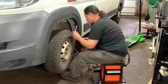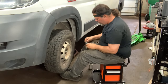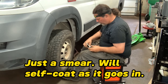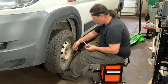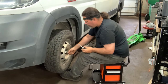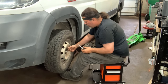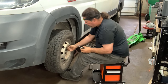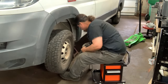I'm going to be putting anti-seize on all these. You don't need much — just a little bit to prevent rust. It seals out water, is all it does. This anti-seize can be any kind — it could even be grease or oil. These anti-seizes would change the torque spec if the absolute torque spec were the most important thing in the world, which it isn't. I'm just getting a little on here so that the next time you do this it won't be as difficult and won't get worse from corrosion.